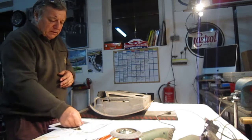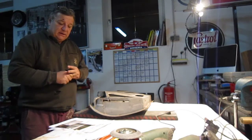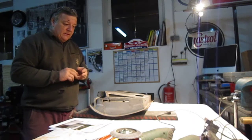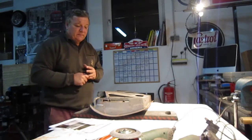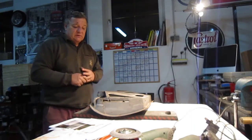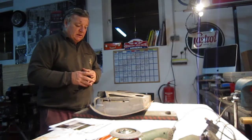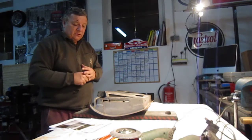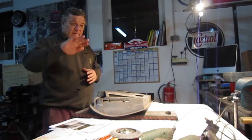I got an email from a chap called Peter Warren — I've been in touch with him for quite some time. He's doing a Jaguar XK 140 fixed head coupe and he's just bought some panels for it. He mentioned that maybe I should remind people: we were talking about not doing small little patches if possible, because it weakens the repair. If you can, go for a larger panel — it's horses for courses with repairs on metalwork. Peter actually cut a part off an XK 150 — it's the rear quarter panel — cut it off, had the new one, and when he put it on he realized there's a swage line on XK 120s and 140s down by the door.